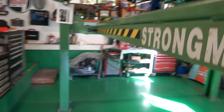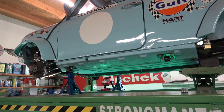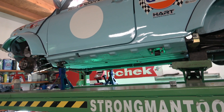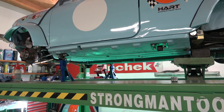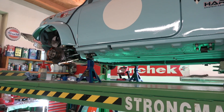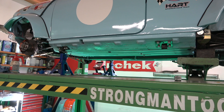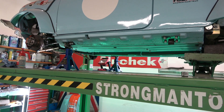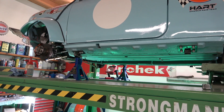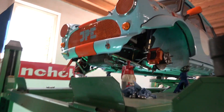This is KAD. You can see it's all solid. It's got a race tank in the back. It's got 113 horsepower at the wheels so if you take into consideration the losses it's probably a good 125 at the crank, because there's quite a bit of losses through the differential, drive shafts and what have you. For an A-series engine which is only a 1310cc - not 1380 - the reason I didn't go for 1380 was that once you get to that bigger bore, if you have a porous block or a crack in the block you're screwed. Me being so far away from the UK I didn't want to take that chance so I kept it at 1310, but it's got a very high lift cam in it.